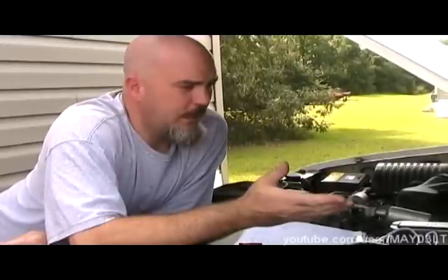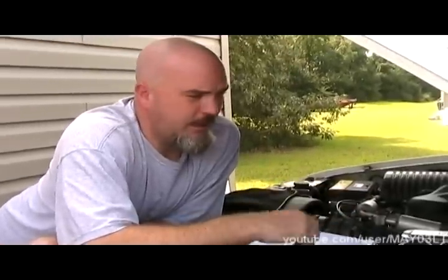So what does this mean in the grand scheme of things? We've passed all our voltage checks here — why can't the cruise control work? I think it needs a new cruise control module. We've collected our evidence here, and this truck needs a new cruise control module. And that's what we're going to put in it — but we're not doing it in this video.